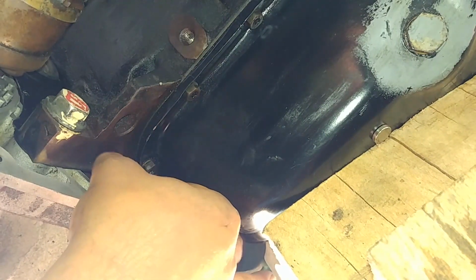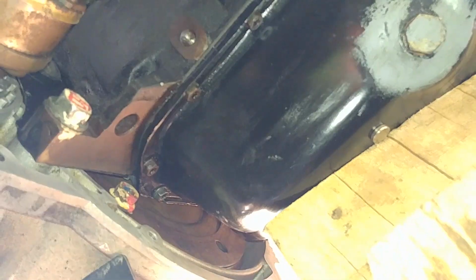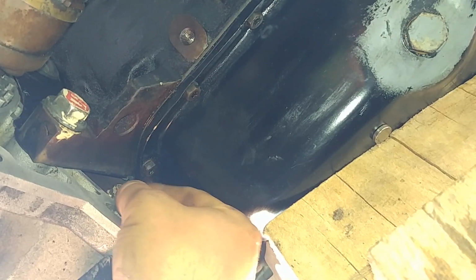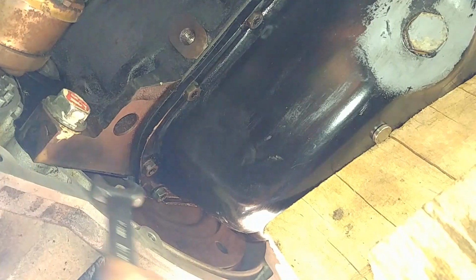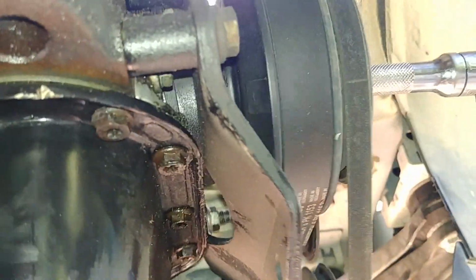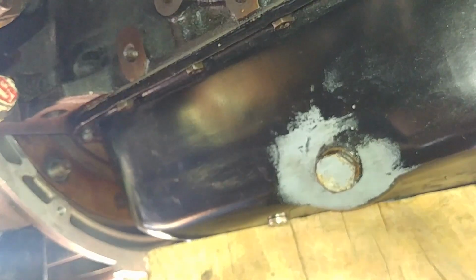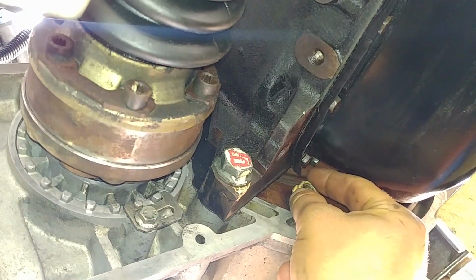We're underneath. First nut is ready. Started by hand. Just nice. See that mark? Red paint marker. There is our first one. I just put the torque converter in the same holes as how we removed it, and then started turning that little nut with a wrench, just enough until it stops. For the second one, turn the crankshaft with a ratchet, always clockwise, until the second stud is showing up. Here we go, that is a stud. Okay, ready for a second nut, same thing.